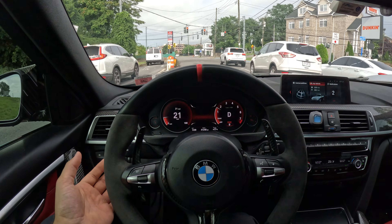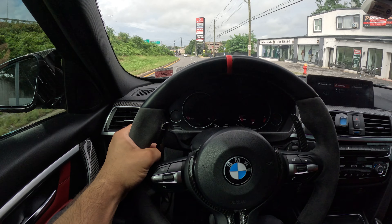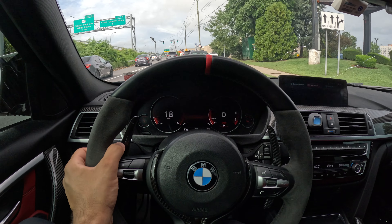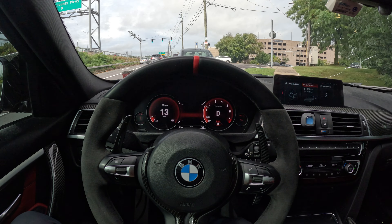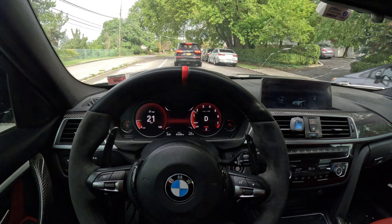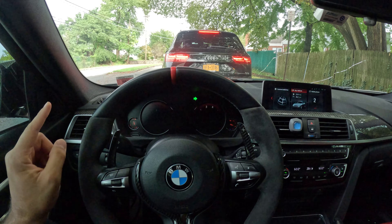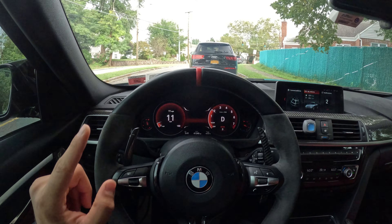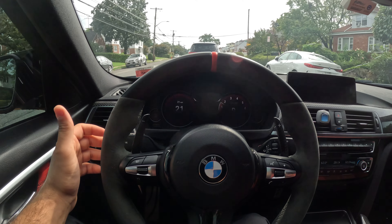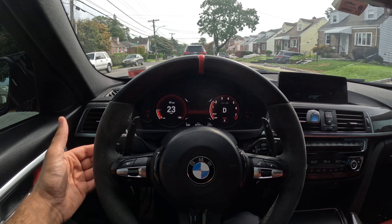When driving this car in its stock format, the ride was kind of floaty — that was one of my biggest complaints. These springs definitely solve that; the ride is a lot more stiff and feels more stable, especially at high speeds. However, it's a little rough — more than I was anticipating. The car feels super bouncy, which is not great for a daily driver. It just reminds me of my old Honda Civic when I lowered it on H&R Sport Springs too. To compare it to my M3, which has an amazing suspension setup — that car feels stiff but smooth at the same time, takes the bumps really well. Whereas this feels stiff on the highway and more stable, but the bumps really beat it up.